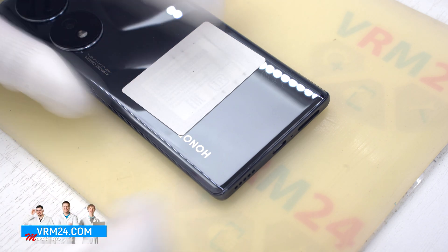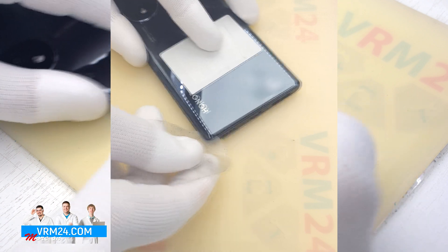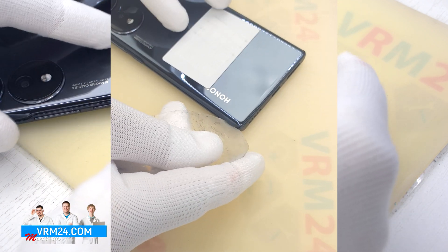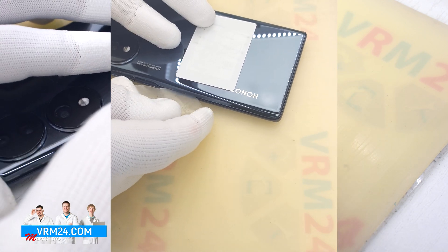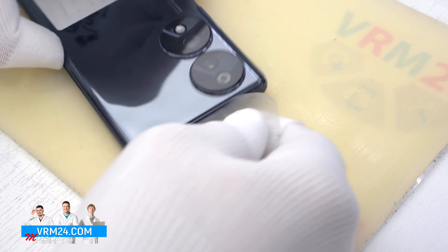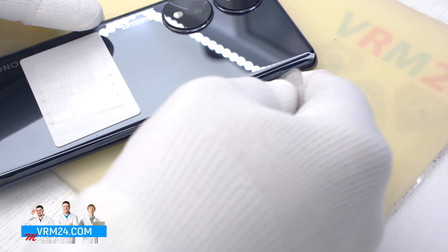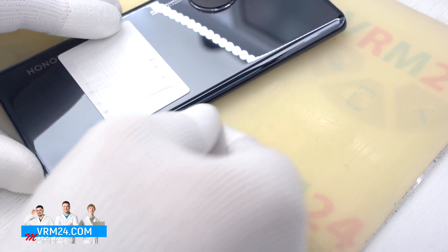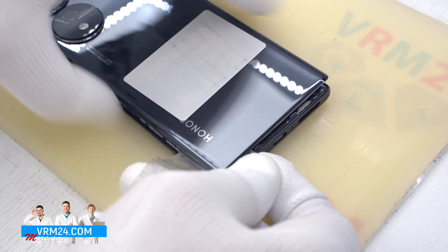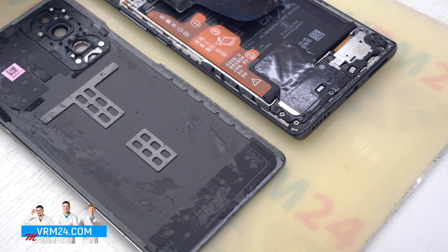After 5 to 7 minutes we can move on to detaching the back cover. To remove it we use a plastic film — this is the protective film from a new display. We insert it into the gap between the middle cover and the back cover and run it along. We always need to be careful around the side buttons and cameras, because there may be cables or camera lenses in this area. And we can open the back cover. We have only the gasket presented on the cover.